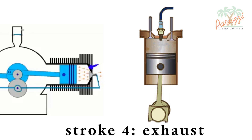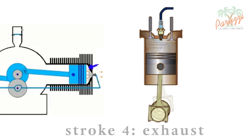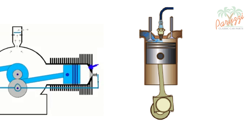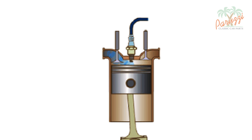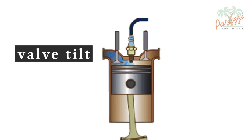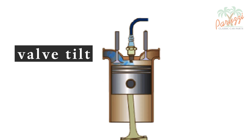In the cylinder there is now a fully burned mixture that must be discharged as quickly as possible. The exhaust valve opens and the piston pushes the burned gases out through the exhaust. The top dead center is reached again — the second time during this cycle. Upon reaching TDC, the exhaust valve closes, and then a new cycle begins with the intake valve opening to draw in fresh fuel. At the end of the cycle, the exhaust valve closes and the intake valve opens shortly thereafter — this is a very recognizable tilting movement of the valves, which we will use in the next video to determine the compression stroke by watching when the valves of cylinder 3 tilt.